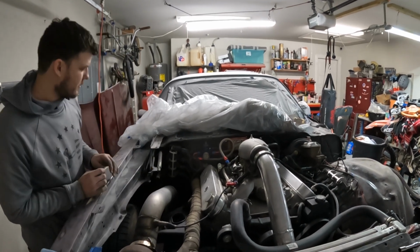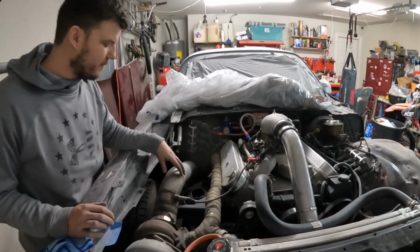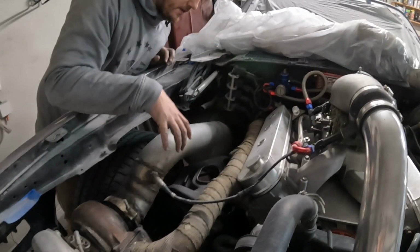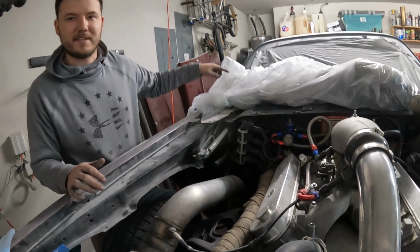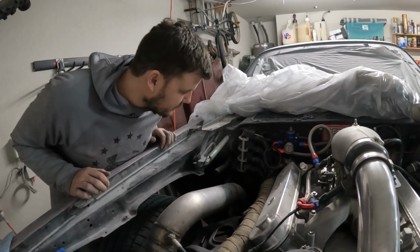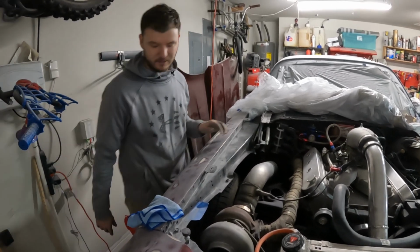After that, got to figure out what to do with the exhaust. That'll be much easier. If I get this fender off, I'll probably be able to do something better with this because I didn't give myself enough room. So I'm on the outside of the frame rail over here, and this big old 4-inch pipe, when it goes down, it was all right at first. I knew it was low to the ground, but as soon as my dad got on this side, we were driving down the road, and every bump we hit, there's sparks flying. So gonna move that. Maybe I'll sneak it over here. So I probably just created a lot more work, but the car will be much cleaner and nicer in the end. So that'll do.